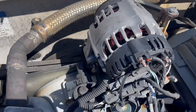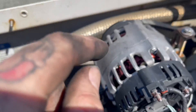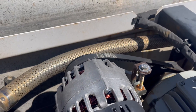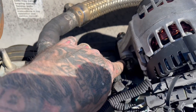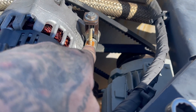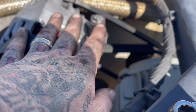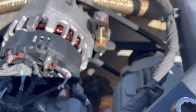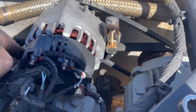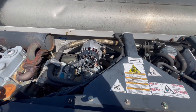Before I tighten any bolts, I've got all my wires tightened up and everything is good. I went ahead and slipped the belt on — all good. The lock nut I haven't tightened yet. I went ahead and put on my adjustment bracket. We're going to tighten that up first to get proper belt adjustment, then tighten the front of it, and finally tighten the lock nut on the back.